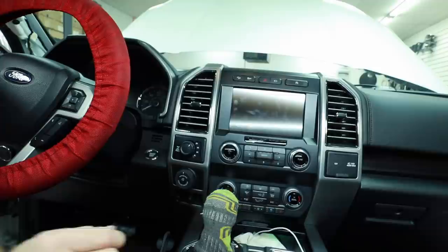Think of it like this — you're going to have to buy some form of a radio. Everyone automatically assumes that because they have a radio in their dash, that part of the expense is out of the equation. It's not. You're still going to have to deal with interfacing. This interface costs about as much as an aftermarket radio, but what it's doing is turning your factory, gorgeous-looking dash — whether it be a Ford or something else — into an aftermarket radio. The whole reason you go with an aftermarket radio is to get that nice ruler-flat output in the preamp section. We've just done that now with our factory radio. It's kind of like the holy grail of what we've been wanting to do for years. Super exciting.